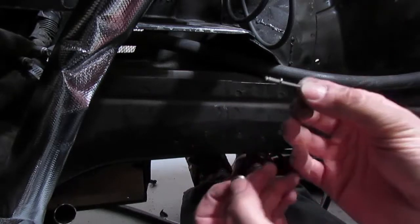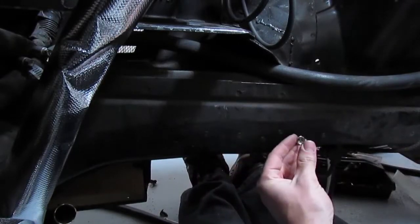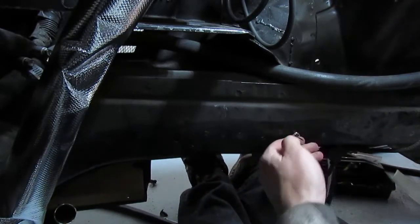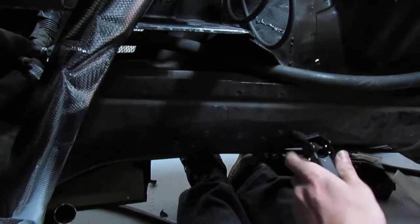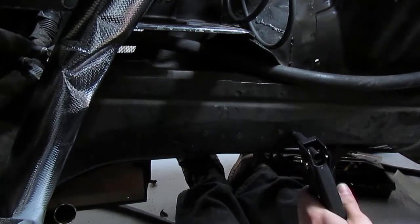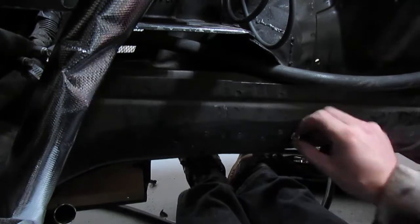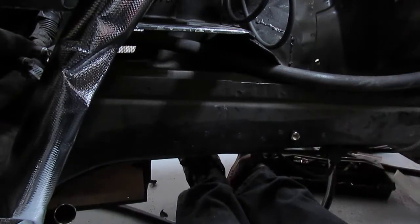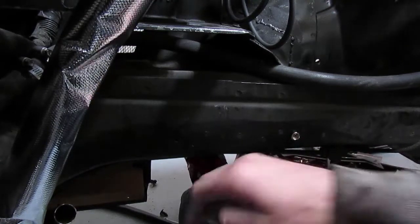There's the button snap — I'm going to use a stainless steel rivet through the center into the hole, and of course the rivet tool, and we're just going to pop these in. Anytime you're working with rivets, be sure to wear your safety glasses — I'm wearing them right now. There you go, fastened into place, very secure, not rattling, not moving at all. Let's do the other three.